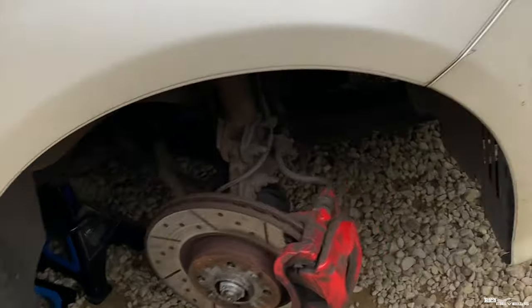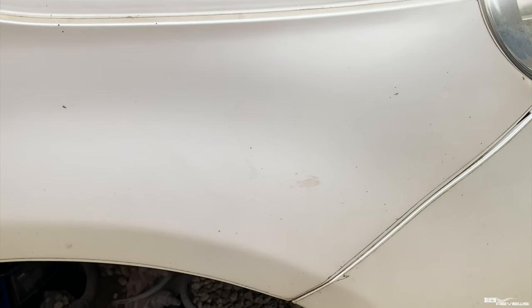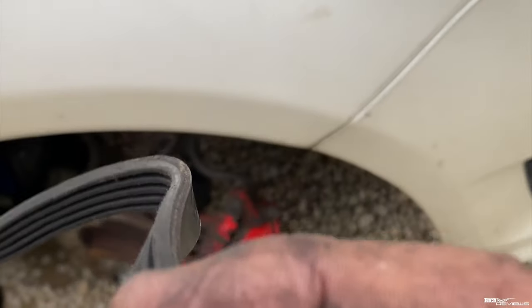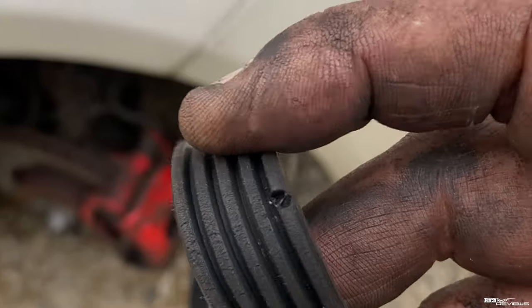Hopefully this video is very useful for you, even though it's quite ad hoc. So this is the old belt. If you squelch the belt, you can see in some places it is cracked — here for example the belt's cracked. So that was going to give at some point; that serpentine belt has clearly been on there quite a long time and needed to be removed. I think it was actually the belt that was causing the problem, not the bearing on the tensioner.